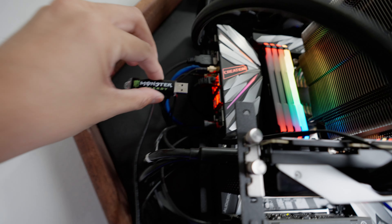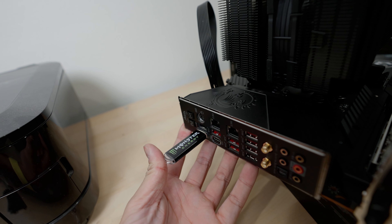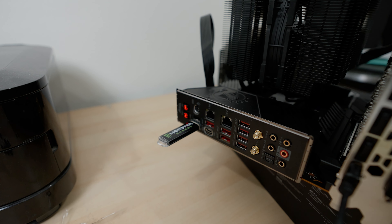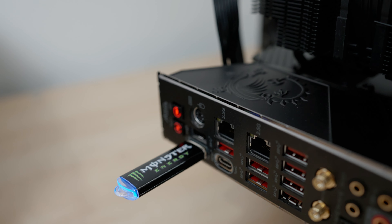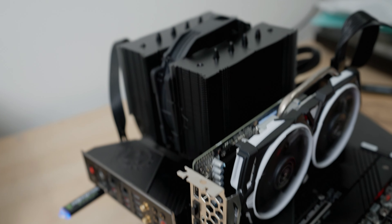Two co-workers pointed out it was weird that the BIOS flash only took about 10 seconds when it should be a minute or so. We're going to try a different USB drive. If not, I have a 12th gen CPU I brought home to plug in and access the BIOS using the M-Flash utility on this motherboard. The new drive went in way easier — here we go, flash BIOS again. It's actually doing something now — it did not go for this long last time. Success! Once the BIOS updated it automatically reset and booted up perfectly.